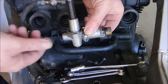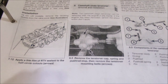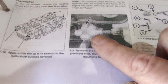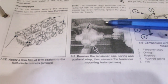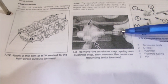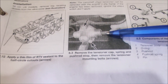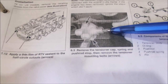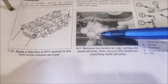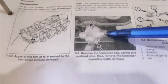So let's have a look at what's going on here. This is the Haynes manual — if I can get in close enough, you'll see that the chain tensioner, which is bolted on the way I've just removed this one, has a threaded piece here which a cap screws onto. That pushes down a push rod, which in turn pushes against another rod in here to push the tensioner up against the chain.